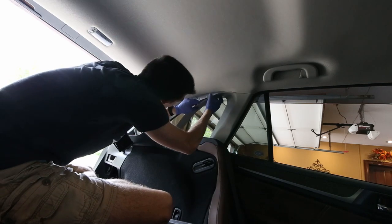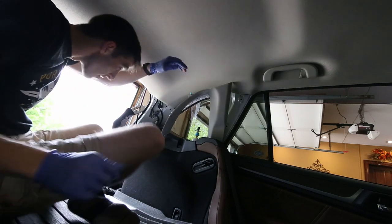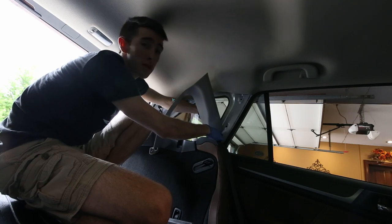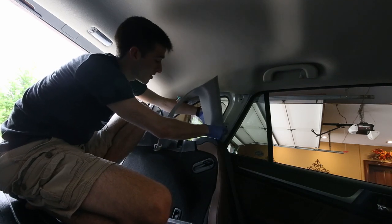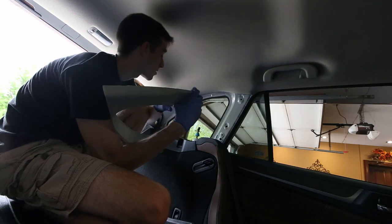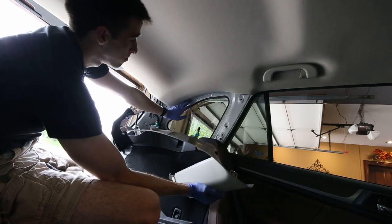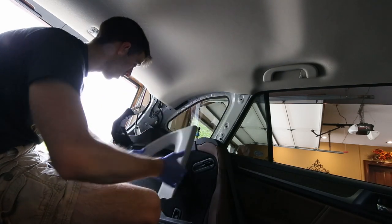That is scratched. Cute. That'll buff out. Alright, here we go. Oh, the fun part. Our little shark fin. Alright, so I found just now, I don't know what all you can see of this because I don't have a flippy screen. But I pulled this piece out. I was able to get my finger back in there to push the little shark fin piece up, get it around the little dump hole, got it out. Again, just like that last side, the little black clip, blue clip, and then the two more white clips. So just those four once you've got the black pin out.